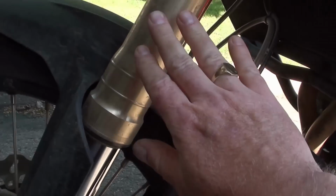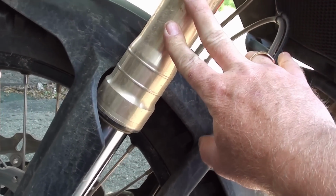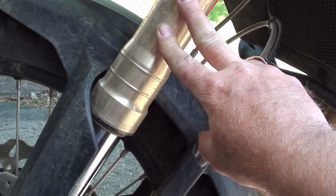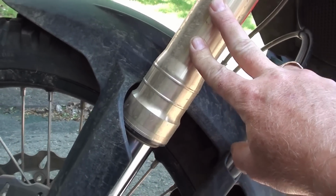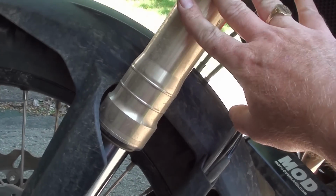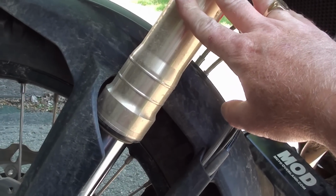And yes, the suspension is not great. I had actually bought some BiTubo inserts to put in here, and they use a gas pressurized strut, and they lasted probably two small rides before they were useless. So I replaced them with the original struts that are in here, but I kept the heavy springs that came from BiTubo, and actually found that that combination works really well for me.